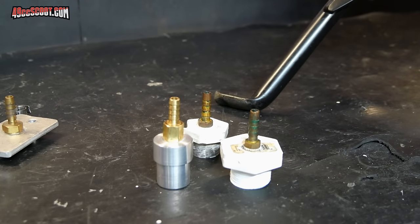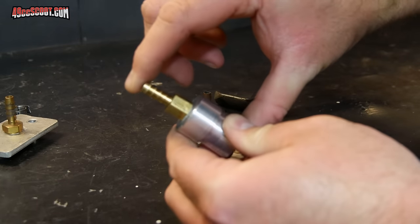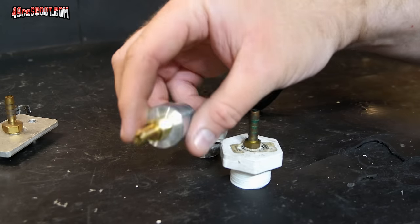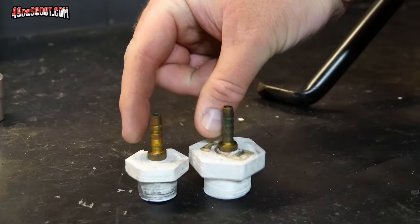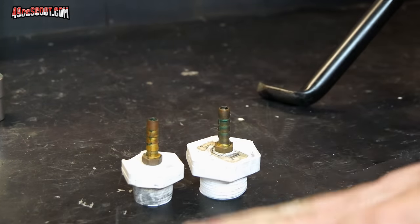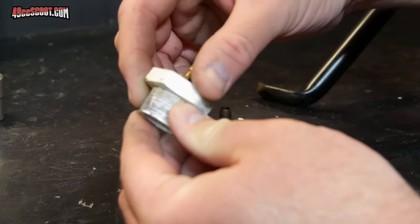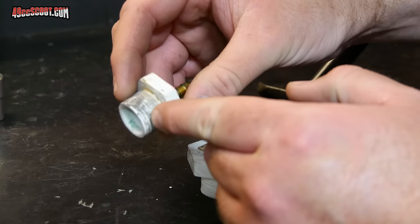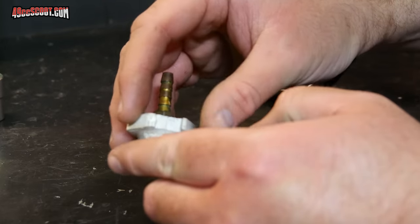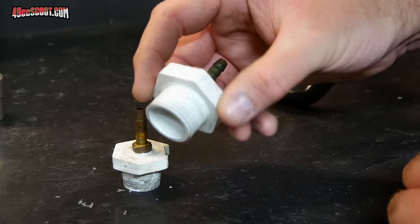Intake adapters like that can be made very easily. I actually made this one in a lathe, cut it to exactly the size I wanted, then tapped it and installed a hose barb — just a brass barb you can get from any hardware or home improvement store. But it really doesn't have to be that fancy. These other two are very cheap and fast to make. They're both PVC caps — I found ones that would actually fit into my intake. These were threaded so I ground the threads off to get a smooth surface for better sealing. Most of the time you can find something without threads that fits your intake. I just drilled a hole through the top, tapped it for 1/8-inch NPT, and installed a hose barb with a 1/4-inch barb.